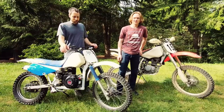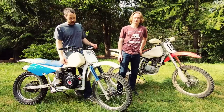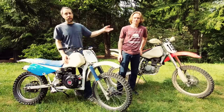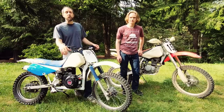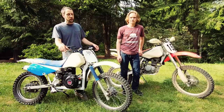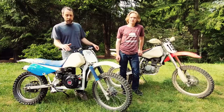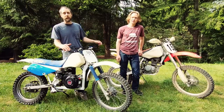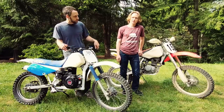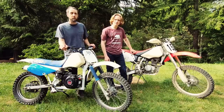All right, so to kind of explain why this bike was engineless and I started on this project to mount this engine in, quite a few years ago, this is my nephew Liam. He had this bike and we tricked out the motor. It was an XR100. We tricked out the motor, put a BBR 120 kit in it and hopped it up and put a nice exhaust and different carb on it. But he outgrew the bike so quick that we ended up getting this CR80 that had a locked up, frozen up crank on it. Pulled the engine and re-welded the frame to fit the BBR 120 engine in here and made him a really good trail bike.